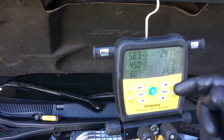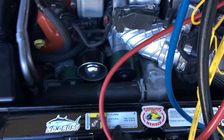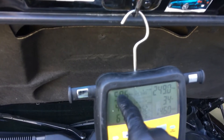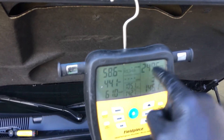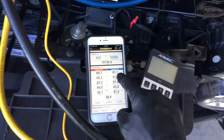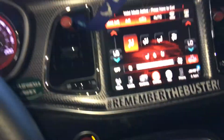Look in the last video and I show you. So I charged it back down to 624 grams instead of 700. Here's our pressures — our low side is still too high, our high side is still too high. Our cooling out the dash is only 61 degrees. It's kind of operating like it wasn't a variable displacement compressor, but I know they have that funky heat exchanger in there. I have it on max AC, I'm trying to get it down cold.